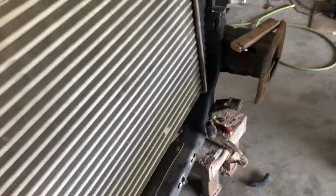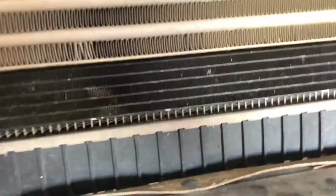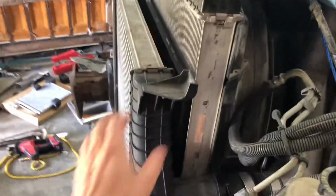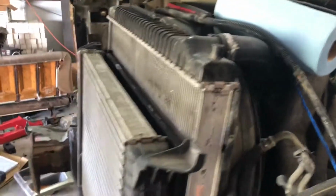Now, is it better to have this thing up, build a bracket to raise it up? Because I don't know, there's not much airflow right there. But if I build a bracket to raise it all the way up, I'm looking at, some of this might block it. I'll just have to see. But it fits. So all we really had to do was relocate the trans cooler, which, if somebody found one that was that tall, that might work. That might still be an option.